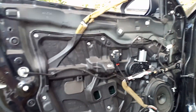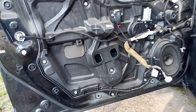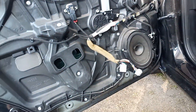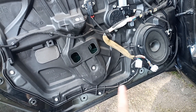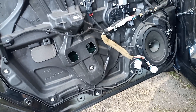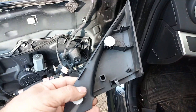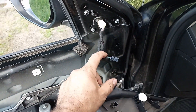I just took out the door panel from the Mazda 3 and I need to take this whole plastic piece off to get access to the back. Problem is I forgot to put the window back up, so I'm gonna have to plug that back in - no big deal. Interesting thing here: there's no tweeter, but there is a plug for a tweeter, so that's kind of nice - everything's already there.